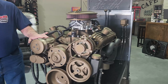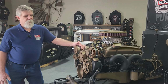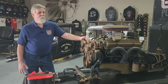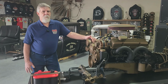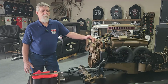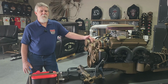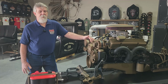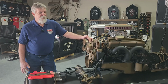Next on our list was power steering. Power steering has always been an issue. If you've ever installed a commercially available power steering hose kit, most manufacturers included at least one field attachable 3-piece reusable fitting that went on braided stainless Teflon lined hose. We've used the Teflon lined hose for years because it'll withstand the pressure requirements of the power steering system. But on a lot of cars, that's the only braided stainless hose on the entire car. We wanted that to also match with our air conditioning and heating lines.